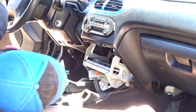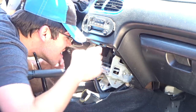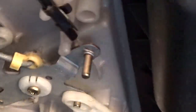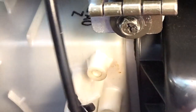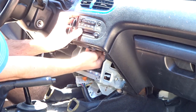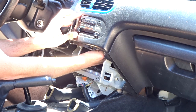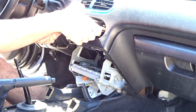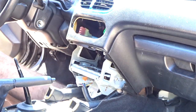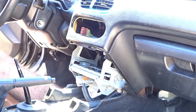There is a cable you have to disconnect — it's underneath the glove box on the passenger side. This cable here is where the signal comes in from the AC control box; it controls temperature. You just want to disconnect that cable and then your AC unit should be able to slide out. With that cable disconnected, there shouldn't be anything else holding it in place, so slide it on out. You'll also want to disconnect some harnesses — and that's it, your climate control is out.